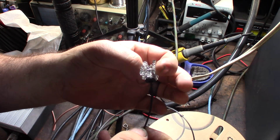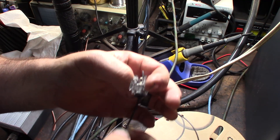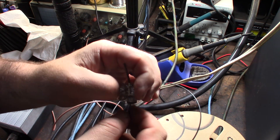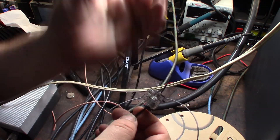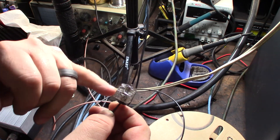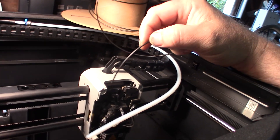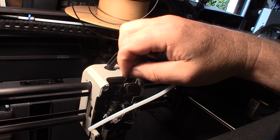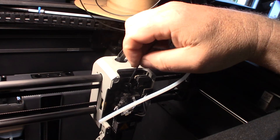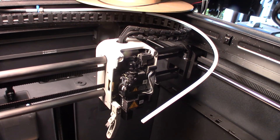I heard something crunch when I popped it off, so something may have already fallen out. Right now it looks pretty clean inside, but now it's really easy to move through — before it was really difficult, it was locked in there. There might have been a small piece preventing the spring from going back. I'm going to blow it out with the air compressor just as a caution. Now filament goes down through it easily, whereas before it was very hard to push through.